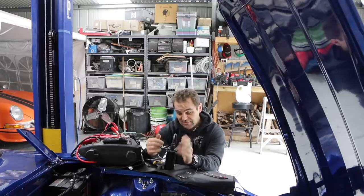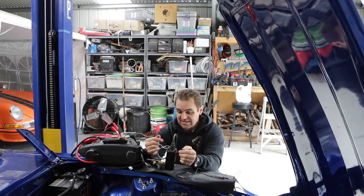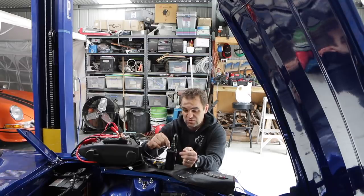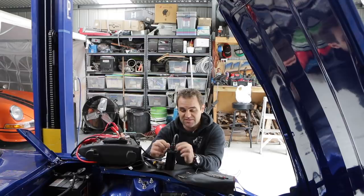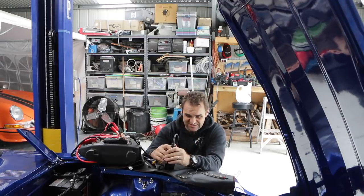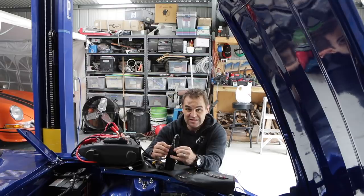So after my big spiel about how coils work, I couldn't get this one to work either. And what I was doing wrong, and I've realized now, is I should have constant positive going to the positive side of the coil, and actually alternate the ground in, and that then created a spark from my spark plug, so it is working. That's a relief. So now I'm gonna swap this in, and I'll try again and see if my distributor is working, but I still think the igniter is probably toast, but let's give it a go anyway.